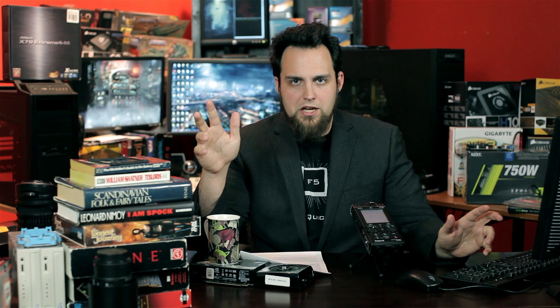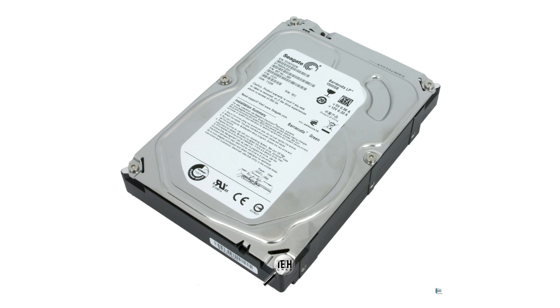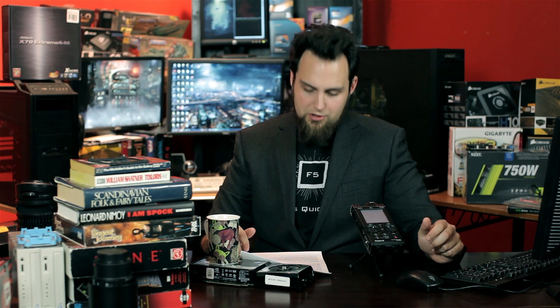In this system I'm grabbing two hard drives — one for storage and one for speed. For speed I'm going with the Kingston HyperX 3K; you can get the 120 gigabyte drive for just around $80 right now, which is ridiculous. For storage I'm getting a Seagate Barracuda Green — it runs at 5900 RPM, so not quite as slow as 5400 RPM but not as fast as 7200 RPM, and it's cheaper and uses less power. I'll use it for storing media and pictures. If you want faster game load times, grab a 7200 RPM drive or a bigger SSD instead.